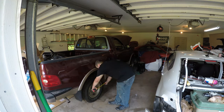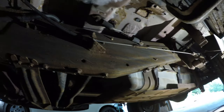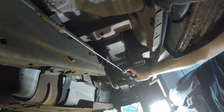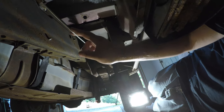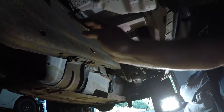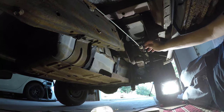In this case, we get roughly 120 inches. Under the truck here, we have the front cable piece here — hopefully the camera picks up on that. This is what the pliers that we bought are going to be used to unclip. And then you have your mechanism back here that connects the left and right emergency brake cable. We'll disassemble this guy first with our new pliers. The front cable actually doesn't look that bad, so we may leave that. Honestly, the rest of the cables don't look that bad either, but it's very stiff to push.